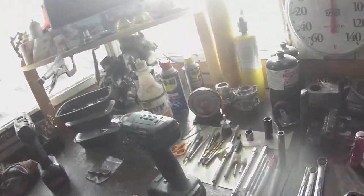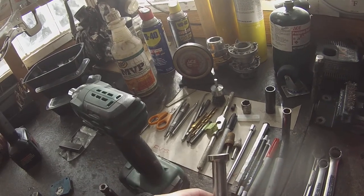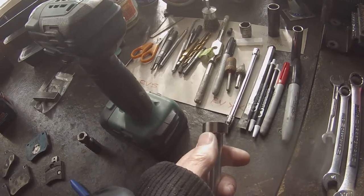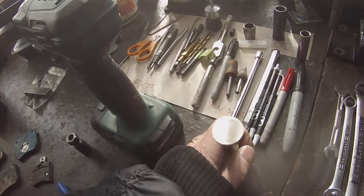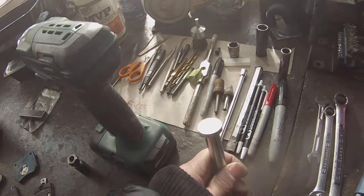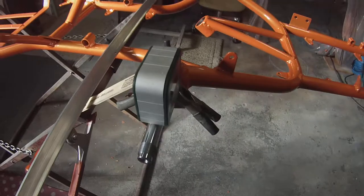We can't just turn the shaft. What we did is we marked the stub axle itself. You can see the disc grinder marks — the sanding marks left in here. It's not too hard to use those and kind of eyeball the center. The lowest point here is going to be the center, and the highest point on the other side is the center, and they line up with the pattern of that sander mark. So I just put a mark with the magic marker — a dot top and bottom, guessing as best I could, just trying to get it top and bottom straight in.